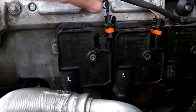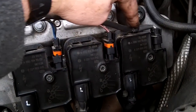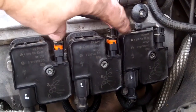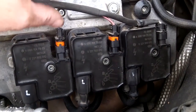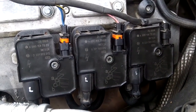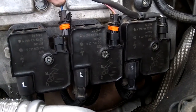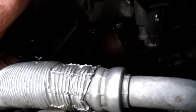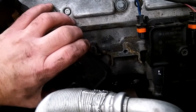Now you've got the engine jacked up and the coil packs unplugged. You only have to unplug the front two — the third one has a little tie wrap, but once you take the first two off the third will just stay connected to the wiring and you can leave it there. These wires can't possibly stretch between where they're supposed to go. Move the coil pack over and you'll be able to reach down, grab the spark plugs and pull them out. Don't pull by the wire — pull by the metal base.